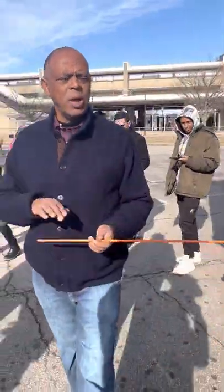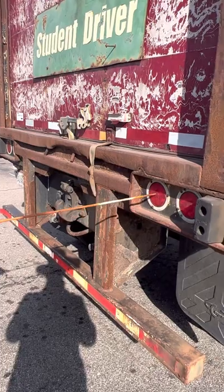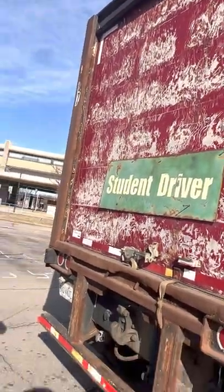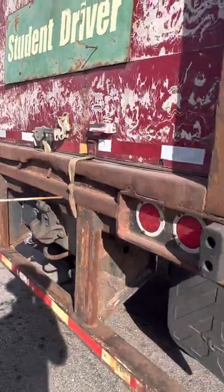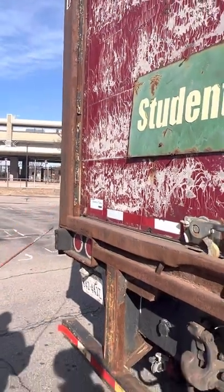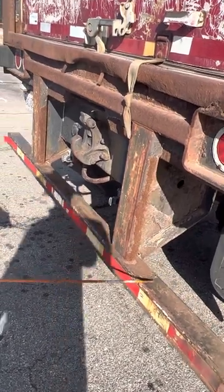When we go back, we have another light — signal light and also brake light. You need to check the screws — it has to be secure, no missing or loose, properly colored, and it has to be in working condition, and also no broken lenses. We have on the top three lights — they are marker lights or ID lights. And on the side here there is another light — that's ID light. Make sure they are all inspected the same way. We have a door, and we have a door latch here — make sure it has to be locked. This door is a rolling door, so there is a cable — no missing cables, it has to be tight and secure. We also have DOT bumper here — you need to check all the stickers, and the bumper itself: no damage, no illegally welded, and no crack or broken.